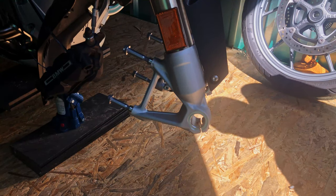Run the caliper bolts down and torque them to 35 Newton metres — please check your own manual, especially if you have the Brembo setup on a 1200. On the right-hand side, slide the caliper onto the dowels — the pads were parted when we removed it, so they should slide on easily. Fit the two bolts finger tight for now, then torque those to 35 Newton metres as well.